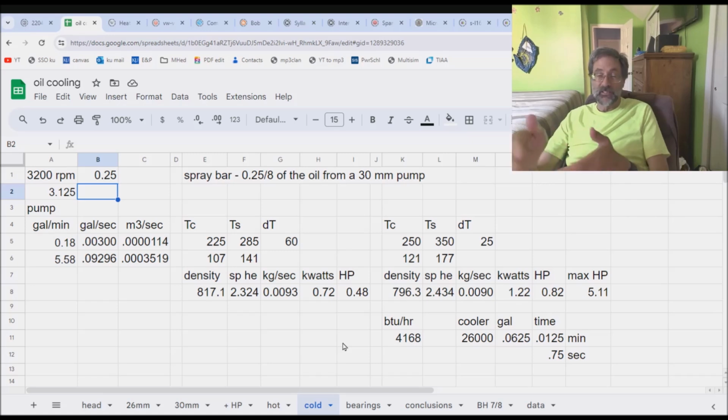It's not just because I'm telling you that they don't need it. The bulletin for the Type 4, if you needed a bigger oil cooler, they would have had to have addressed the issue of the elevated oil temperatures, and there was no need to address it. They didn't address it, therefore it doesn't exist. The stock cooler is more than adequate to deal with spot cooling. There you go. So that kind of summarizes it. Spray bars might be a little bit effective if you're bleeding edge and you really want it. Spot cooling after that. The rest of it, no.